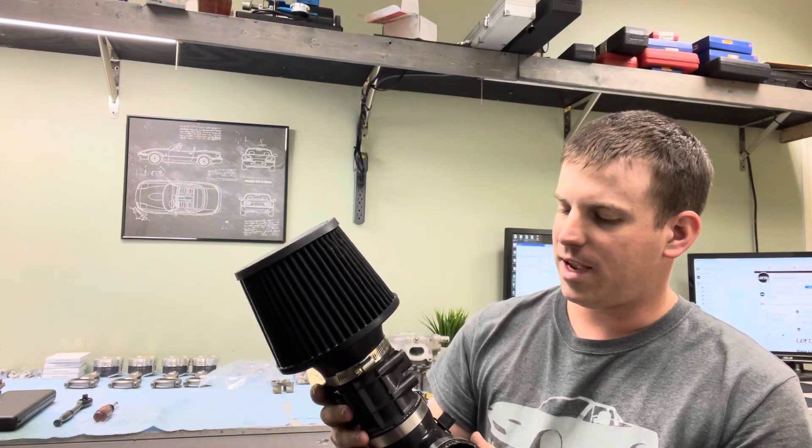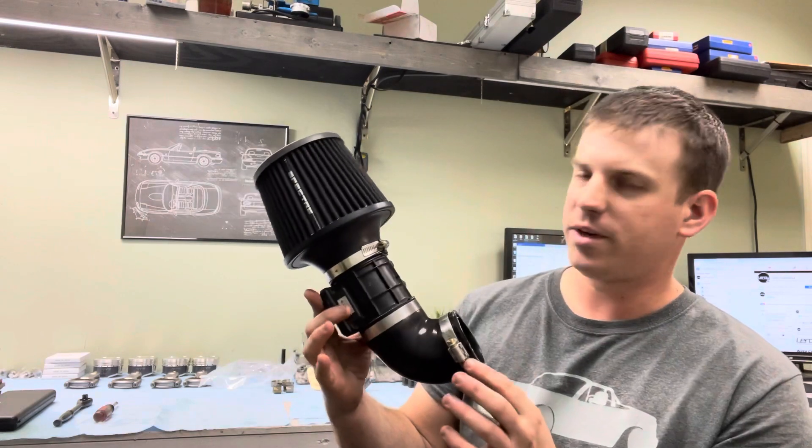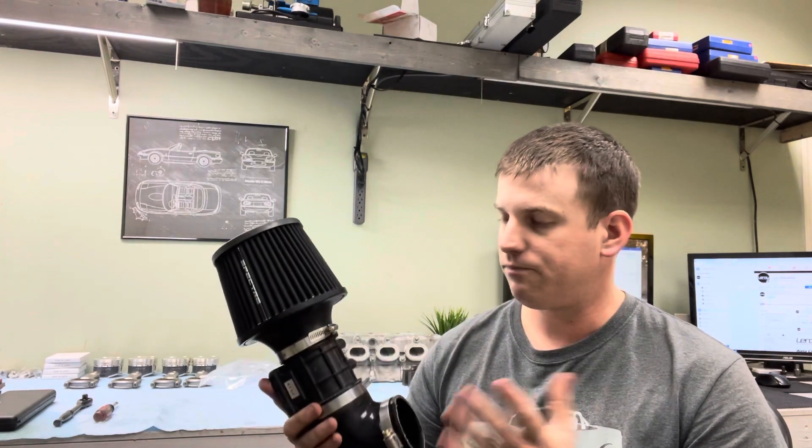This happens a fair amount — you have your hypothetical best case scenario, but your implementation of that can only be so good. I've always run these short-style intakes only because it looks so much better, and mentally something bugged me about having the intake right next to the exhaust. I liked it flipped around, but I'd always been bugged about people saying you're losing torque, you're losing mid-range. I've seen the dyno graphs. I don't doubt that in an ideal situation that is correct, but in the real world, choosing colder temperature air is more important than the difference in runner length. We're talking single-digit horsepower numbers here — not make or break scenarios — but in a car that's only got 140 to 150 horse anyway, it's a pretty substantial chunk.